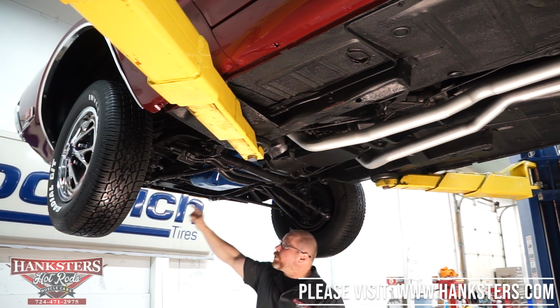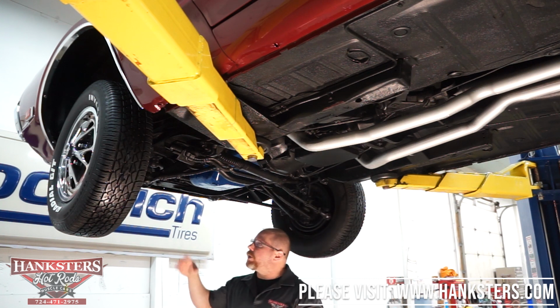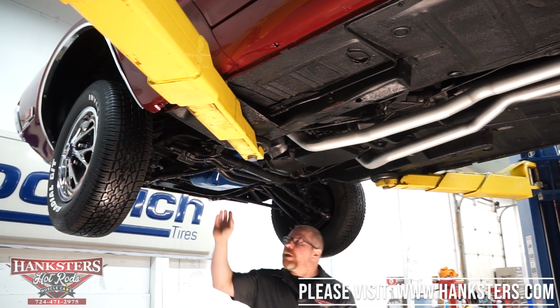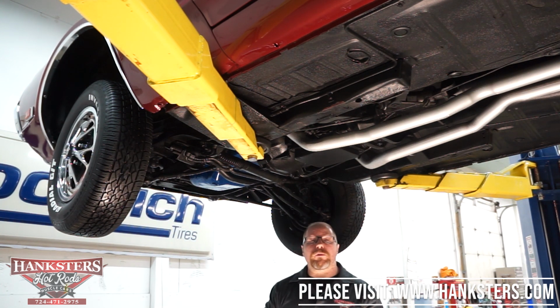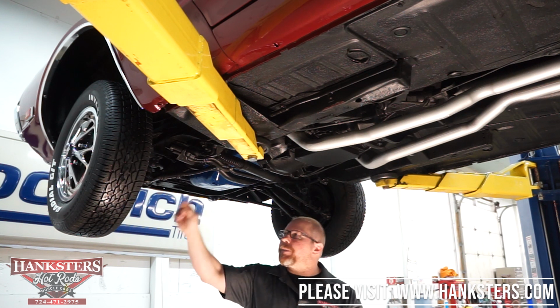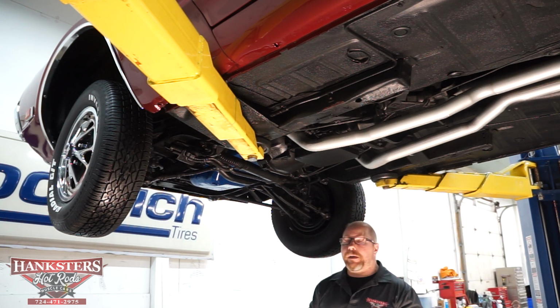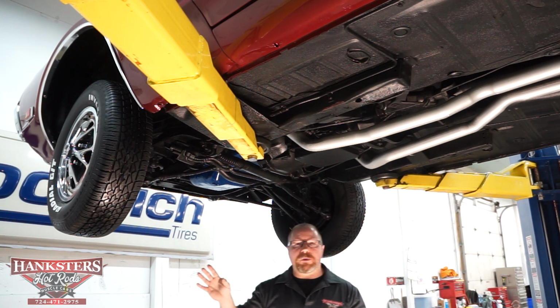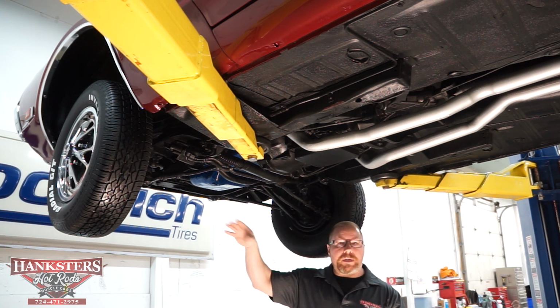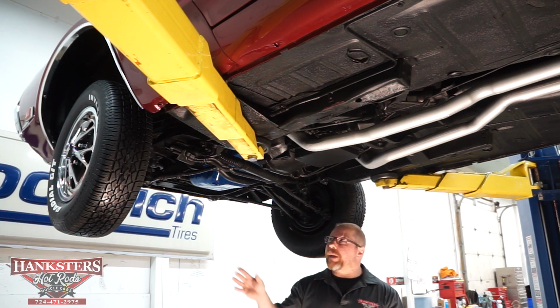And again, all your bushings there, those are all in good shape too. They're not split out or dry rotted or cracked or anything. They look good. Ball joints and upper and lower control arms, those all look well maintained and greased also. The steering, your tie rods, same thing here. All of your ball joints on all 4 ends there are all in good shape. Rubber dust boots are intact, keeping the grease in, keeping dirt and debris out, and again, greased and maintained.